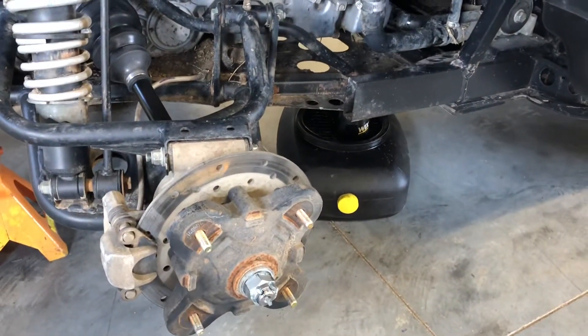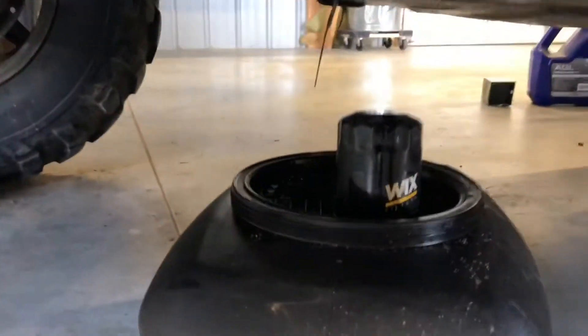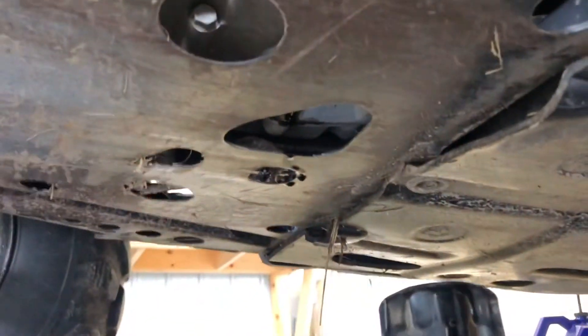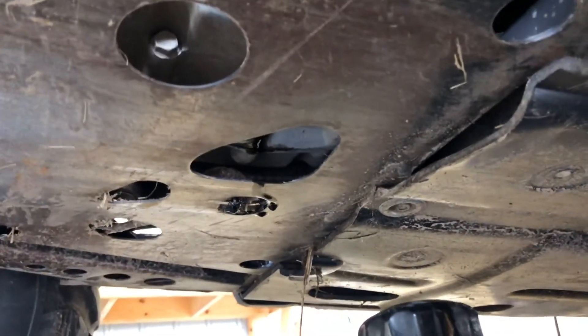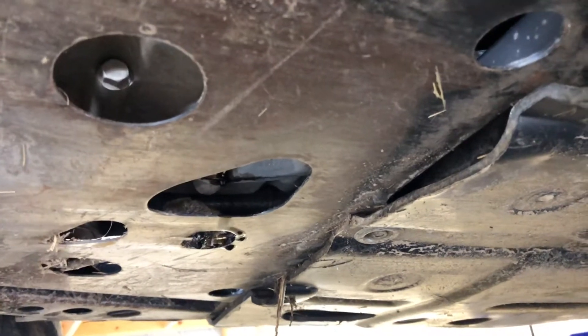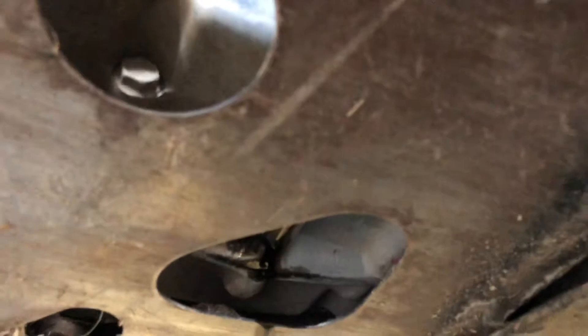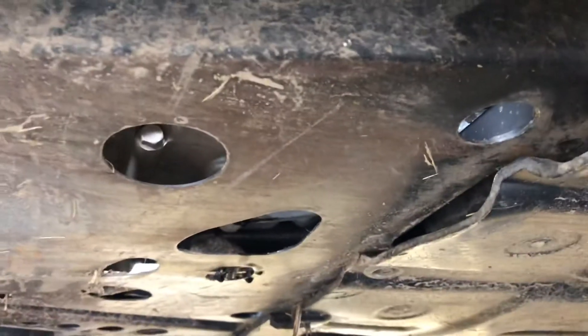To replace brake pads, check my videos on how to do that. The engine drain plug on this machine is hard to see — it's underneath in the larger hole in the skid plate. There's a small Allen plug underneath that needs to be tightened to 12 foot-pounds. Engine oil is dripping at this point, so I'm not going to put the camera underneath there.